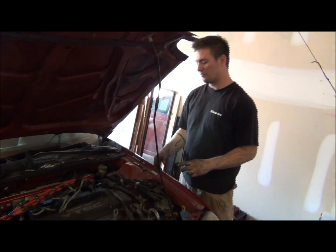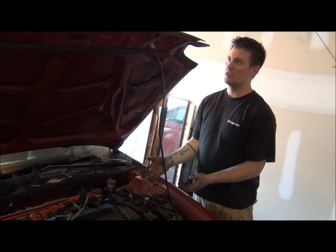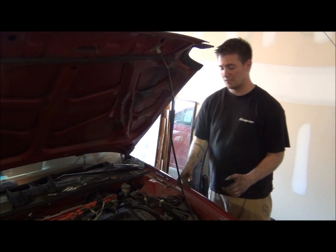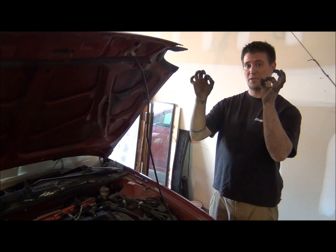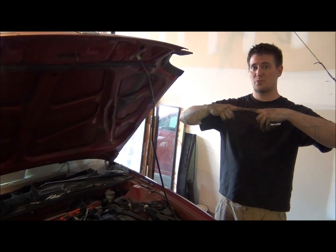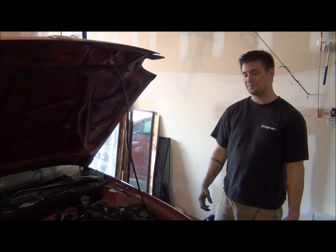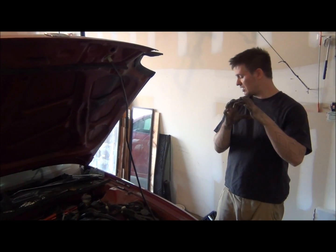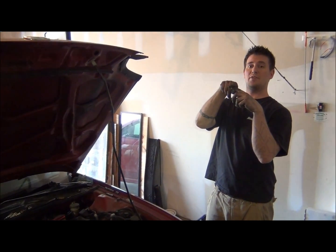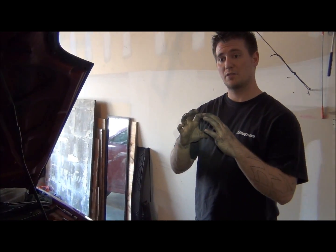dead center. And what you're looking for on top dead center, on these gears, I'm trying to think of what it is on the regular ones. I don't remember. On these here, I've got 2 lines that go up with circles around them, and that's both top dead center, and there's 2 lines on the inside that point towards each other, and that's when you know you're at top dead center on cylinder 1 up here. And then the bottom for the crank, if you look at the keyway that goes into the crank, it should be sitting at the very top of the crank gear for the belts.